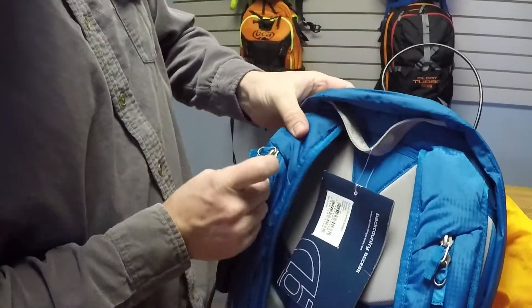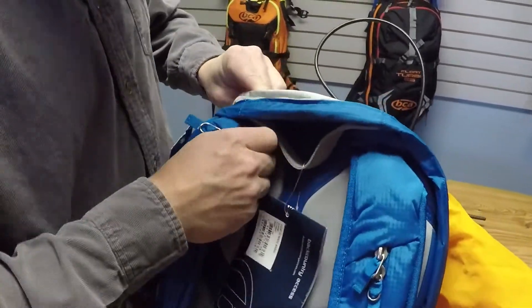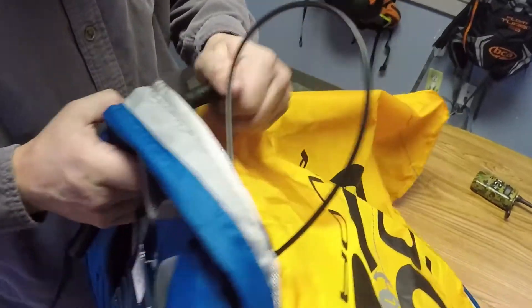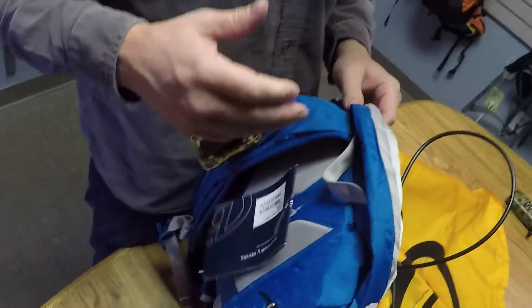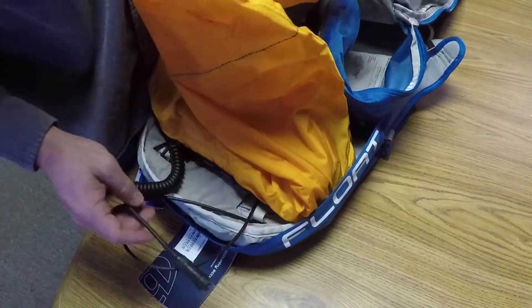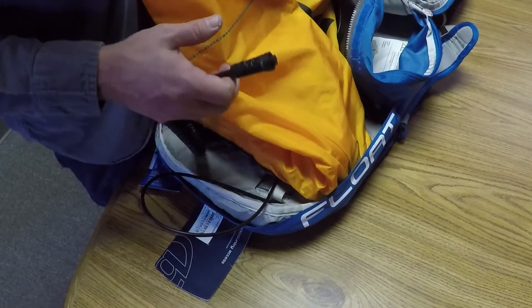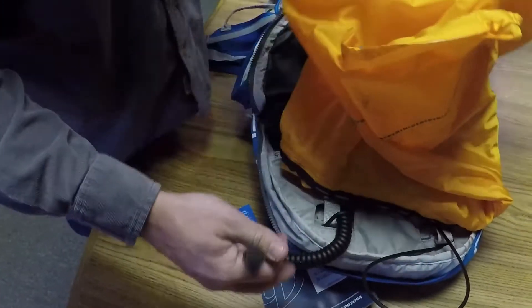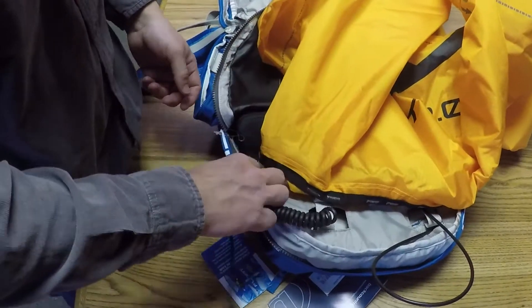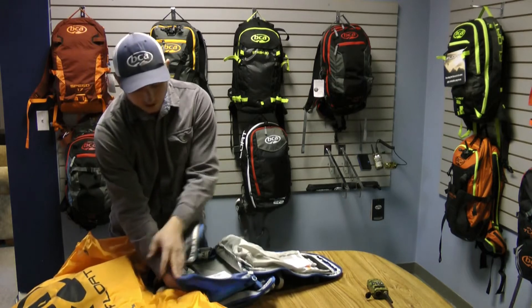Just going to guide this part of the cord up into the main compartment, pulling as much slack through as I can for now. We can always adjust where the mic sits a little bit later. You can either route the cable to the right or the left side. However, I would recommend routing it to the opposite side of where your trigger is coming through — that way there's a little less cable needed. Both sides of the airbag compartment have openings that go into the main compartment.